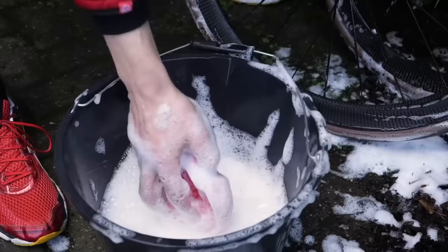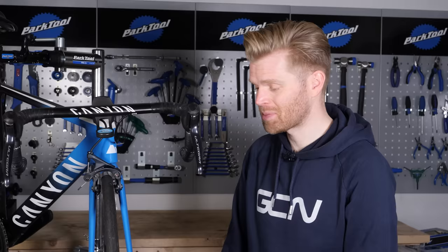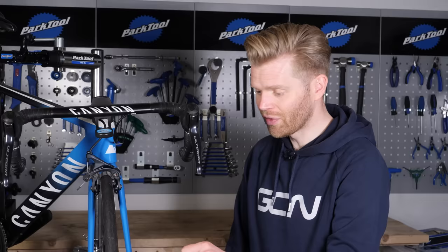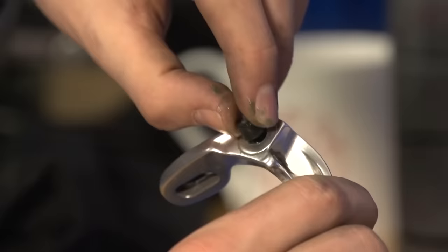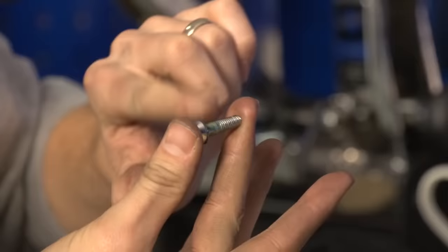If you're cleaning your calipers, it's worth cleaning your rims as well — you should clean your rims as often as you clean your bike. The more you keep your rims and the inside of your brake pads free from dirt, the longer your brakes are going to last. Soapy water is your friend and the best thing to use. I'd avoid using PTFE sprays like MO94 because they reduce friction and will compromise your braking. We do have a specific video that goes into more detail on reconditioning your calipers, so make sure you check that out.